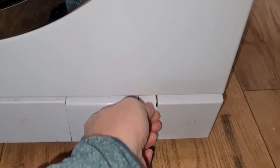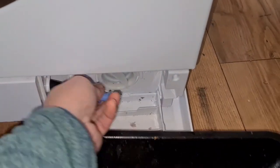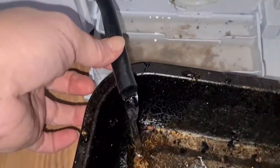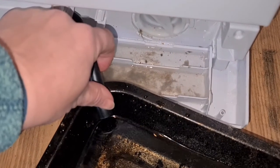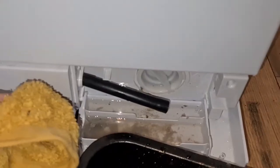You do this by removing the little front flap and putting a little tray against it. There's a little hose on the left — just pop off that rubber seal and the water will all flow out. Let that run until there's nothing left coming out, and that will be the majority of the water still in the machine. It just saves it going all over your floor.